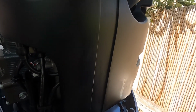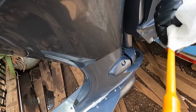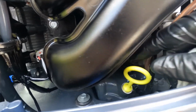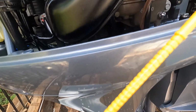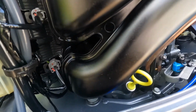A little less. I start with 3 and then start checking. Alright, got just over 3/4 in there. Gonna let it settle. Take the dipstick, dry it off. Yamaha did a great job with this one, with all those little ridges. It is very easy to see with new oil even. That's why some suck. And there it is, about 3/4 of the way up. And then once it gets running, you're gonna lose some to the filter. I'm gonna run it to check, but that should be perfect.